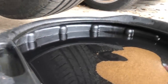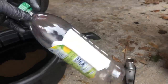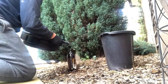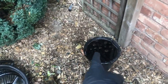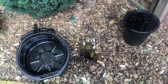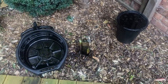Both parts are empty. There's also a pipe I can remove for a little bit more, but we're going to measure how much has come out first using a simple household one-litre juice bottle. Results: 10 litres in the bucket, almost half a litre in the bottle, some residue in the pan, plus some spillage on the floor from removing the sump washers. So we've got almost our full 11 litres — I'm happy with that.